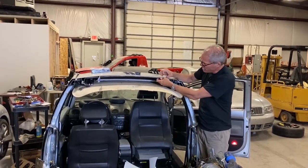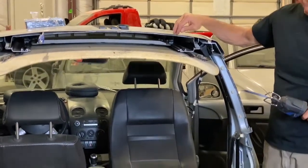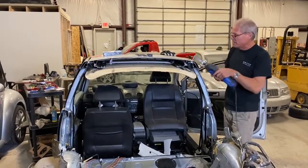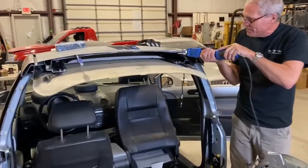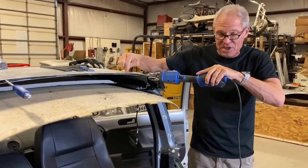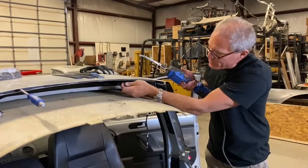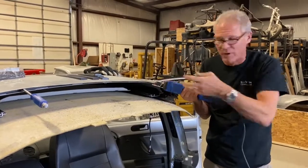On all of the cars though, there's a layer of crud — adhesive — between these two layers. Remember, if you're using panel bond, panel bond needs bare metal. It's a flexible epoxy. So I'm going to take the regular Sawzall that we use for cutting the car and I'm sticking it in here — we've already done this one — and I angle it slightly, basically scraping this underside with the saw blade.